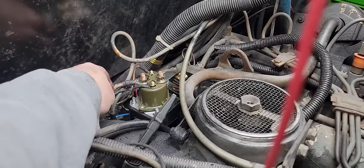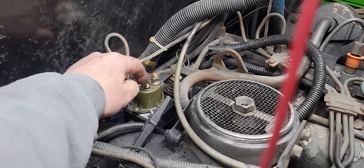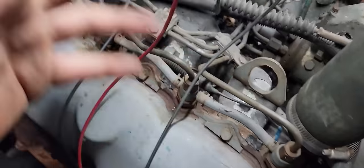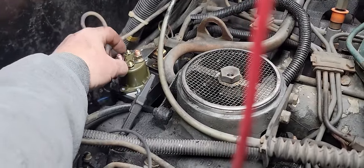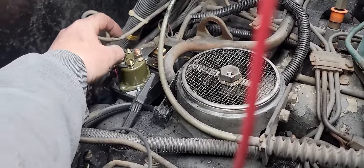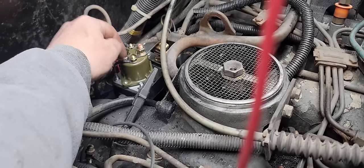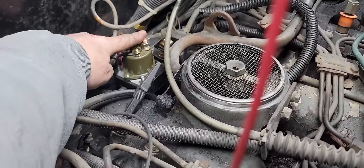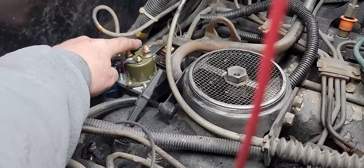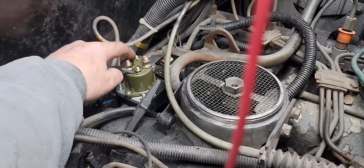So that could be, because we don't have 13 volts across here. We have 13 volts across ground, then to an outside battery source. The same vehicle, of course, but if it was here, then this thing would overheat because you'd kill the batteries, because we'd have constant flow across the battery to the glow plugs. So that might just be how the operation works. I don't know. I think for right now, we're going to go with that and make sure it's not a problem. He doesn't want to replace batteries. He needs to replace batteries, but he doesn't want to.